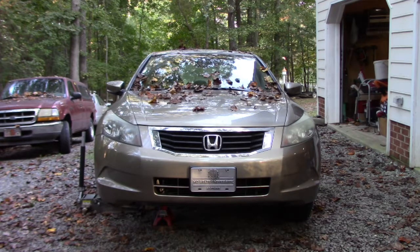Seventy percent of your braking is up front, so that wear pattern kind of disturbed me. There was still some pad life on these pads, but I went ahead and took the rotor off, decided to go ahead and do everything from scratch - new rotors and new pads. I use the Wagner Thermo Quiet. It apparently had some semi-metallic on there because I could see the brake dust. I'll be filming the passenger side for this video.